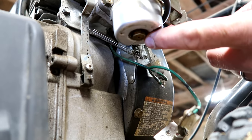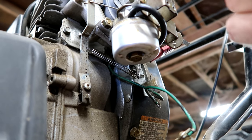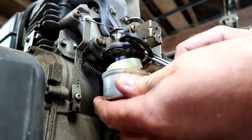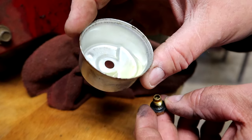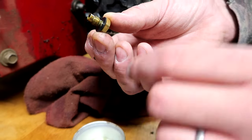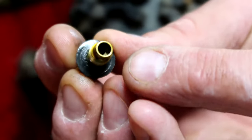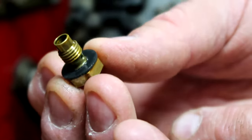What we're going to do — this is the bowl. There is a half inch bolt on the bottom to take it off. We'll drop that down and take a look, see what's inside. First, I'm going to use a clamp and just clamp off the fuel line. I'm going to loosen this bowl and it will just fall right off. You can see there's a little bit of gunk in there, but it's not too bad. The fuel is old, but the main culprit is going to be this little guy right here — the bolt that held it on.